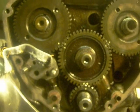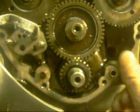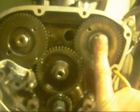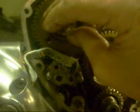That is your valve timing set. All you can do in here is make sure all of these faces are nice and clean. Both the cam bolts are left-hand thread, so they screw on backwards. There you go — that's the oil pump one with the little doody on it.